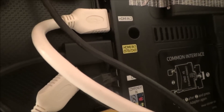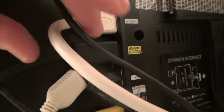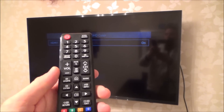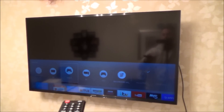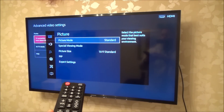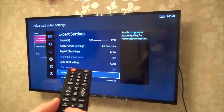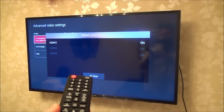On this cheaper TV it's only enabled on HDMI 1, so I'm just going to swap the leads around. Whatever was in HDMI 1 can go into HDMI 3 — chances are if it's a set-top box it won't be using HDR anyway. Now the Xbox is in HDMI 1, so I need to go to Source on the TV and change it over to HDMI 1. Back in the TV settings under Expert Settings, HDMI UHD Color is now on for HDMI 1.